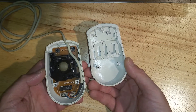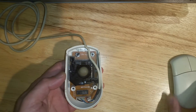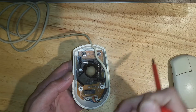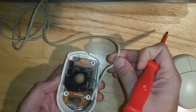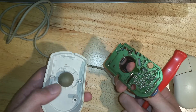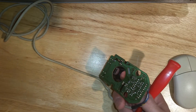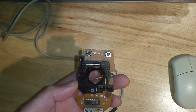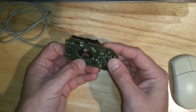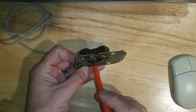You can see the original colour there — nice and white compared to the creamy yellow colour. There were an additional two screws just in here. Once you've removed those, just take the cable out and then the PCB itself just lifts out — but obviously just watch the mouse ball. For those younger viewers out there, that's what we used to have before optical mice. This is also an ideal opportunity to give it a clean.